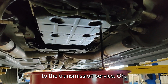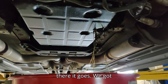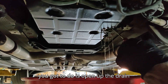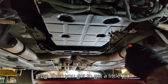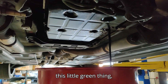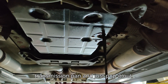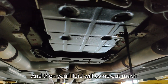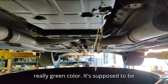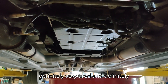We're moving on to the transmission service. We've got our transmission fluid coming out — all you've got to do is open up the drain plug. Then get a pick in there and remove this little green pipe that sits inside the transmission pan, pop it out, and your fluid will come out much faster. It's definitely not supposed to be this really green color — it's supposed to be blue — so our transmission fluid is definitely very tired and needs to be replaced.